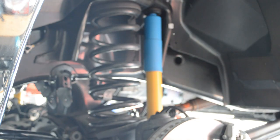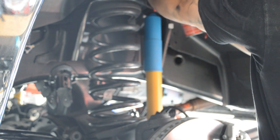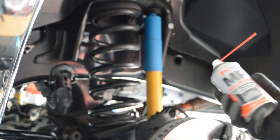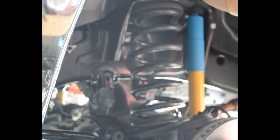We've got the right wrench size. However, the shock studs are pretty rusted, so we're going ahead and spraying them down. We've been testing this Amsoil metal protector — it's supposed to help free rusty parts, similar to WD-40 but made by Amsoil. So far it works pretty well. The wrench size for the upper nut is an 18mm, so go ahead and grab your 18 and start loosening that nut.